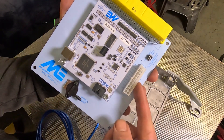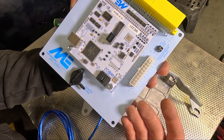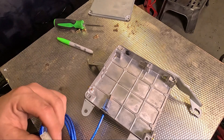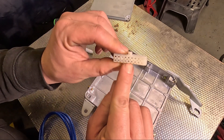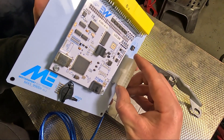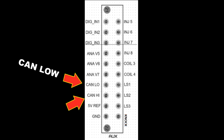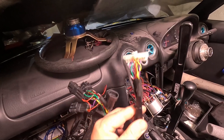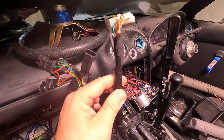This big plug on the side is the options port, giving you more options. For the ME221 Generation 2 board you need to purchase a 557 20-pin male connector block which plugs into the options port. Here's a pin-out of the options port — for the CAN Checked gauge we're only using pin 17 and pin 18: 17 is CAN Low and 18 is CAN High. I've already made a patch lead for my options port and I'll go over that in more detail in the future.